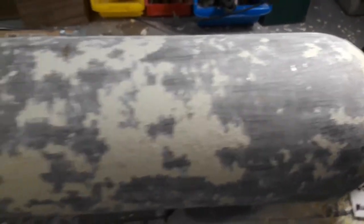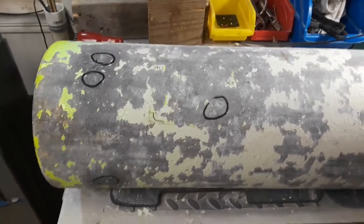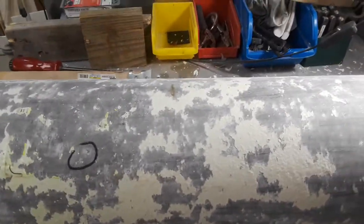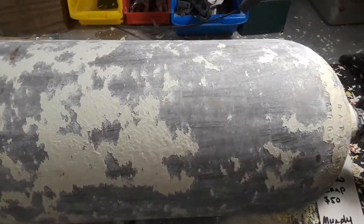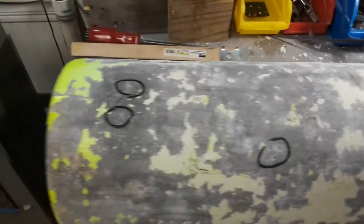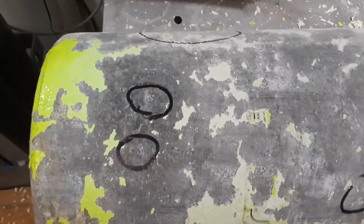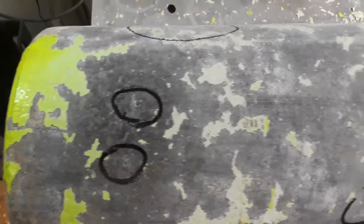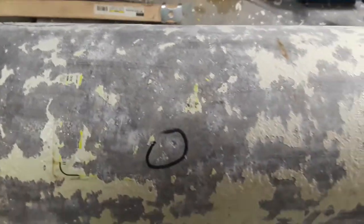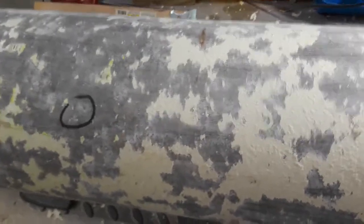Keep in mind, if you are working in the industry and a tank like this comes in for a visual inspection, that paint's got to go before you even look inside the tank, because you may not even need to look inside. If you own a tank like that, it's got to get scraped. If your dive center doesn't scrape it, you might want to do it yourself — I do it, I don't have a problem with it, I kind of have fun doing it.